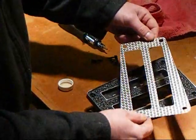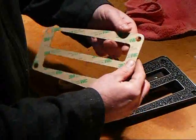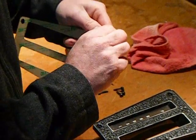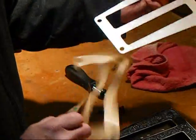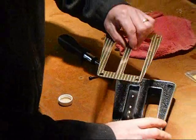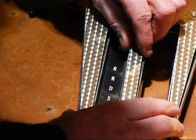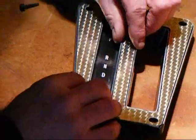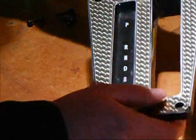That's why we only offer and sell the actual replacement aluminum unit. As you can see, that's an actual piece of aluminum. It's got 3M adhesive on it. So what you're going to do is take your fingernail and you're going to peel it up and off. You got to line it up because these are stamped to fit right in, so you got to make sure that you get it lined up nice to all the openings before you start to smooth it out.